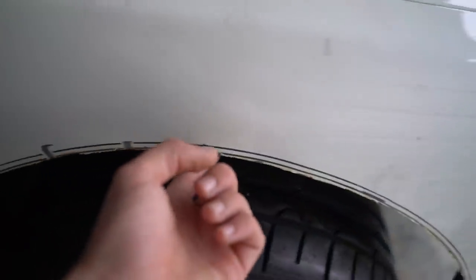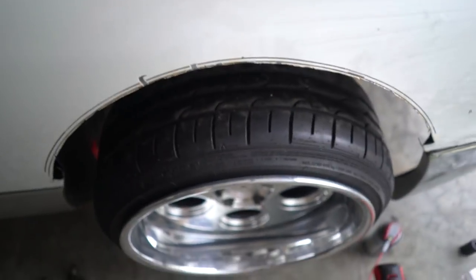On the other side I've made the same cuts and shaved it up a little bit higher, so it's basically as close as it can get. It's not pretty right now — once the flare is welded on I'm going to shave that inside edge flush to the flare so it'll be clean and won't cut up the tires. I'm leaving it as is for now and hoping to get to welding it on pretty soon. I was planning to do that last weekend but had to rely on other people and it didn't work out, so hopefully in the next week or two.